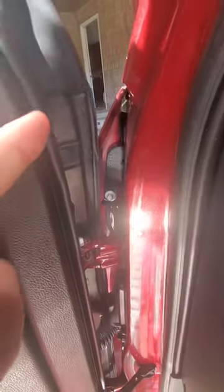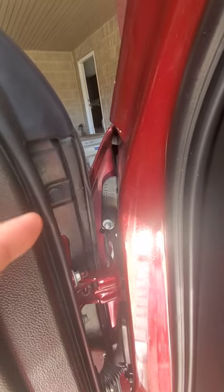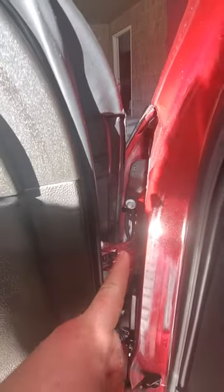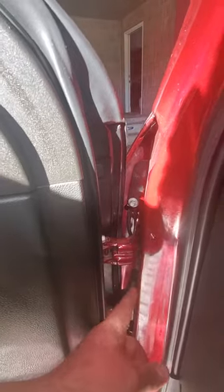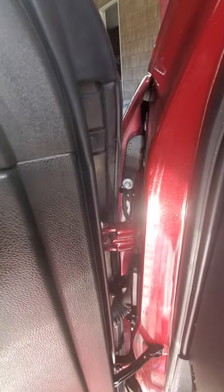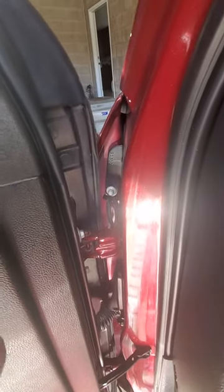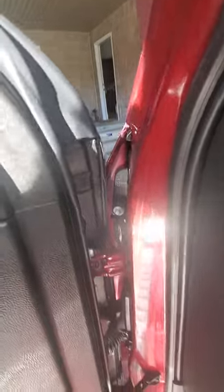So what I did was I took a coat hanger, straightened it out, stuck it through that back hole and ran it out the hole in the fender I showed you. Then just take my wires, take one wire at a time, tape it with electrical tape, and pull it through — got it through this hole and then fed it through the next hole. If you're running multiple wires, you might run into this: one wire went through perfectly, but then as I started feeding the other one through this bottom hole, it kept bouncing up like it was hitting the other wire and curling up. So I pulled the first wire out a little bit, taped the secondary wire to it, then pulled them both through and it came through pretty good.